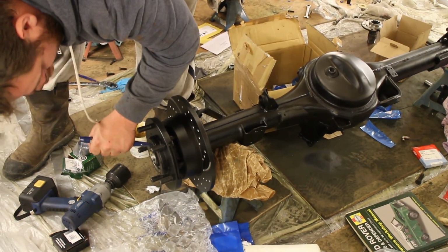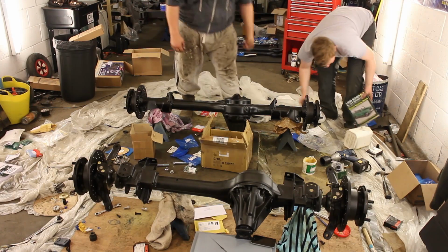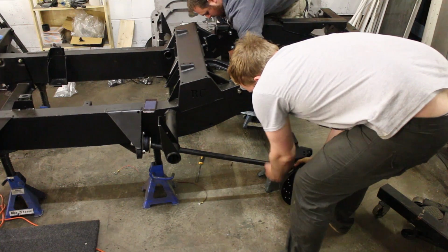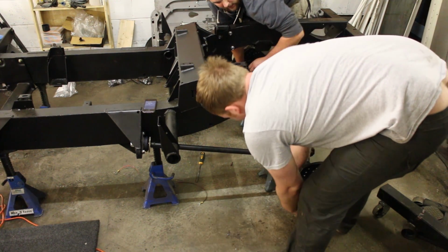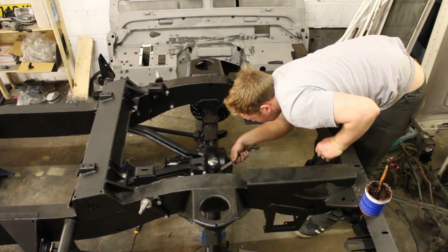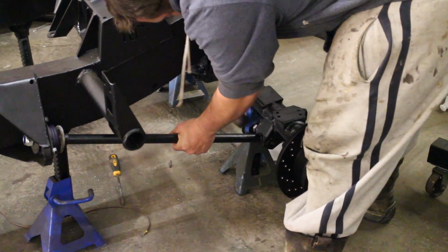And there we go, he's just locking down the lock washer to secure the hub nuts in place. We added the trailing arms, and Carl somehow picked up the entire axle with hubs and disc brakes and lifted that into place. Then using some axle stands and a couple of hammers, we were able to push it into place. I fastened on the A-frame ball joint nut and also the split pin that goes through that, so that's all neatly tidied up, and the bolts for the axle just needed knocking into place.